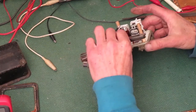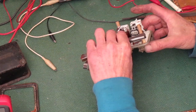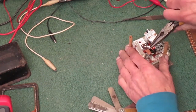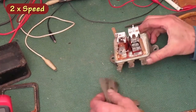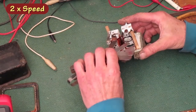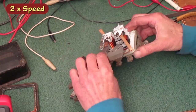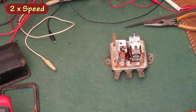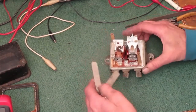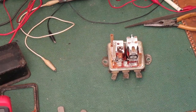That's a little tight. I'm going to check it with the 18 and see if it's close. Nope, that don't fit either. Got to bend it back up a little. Now the 18 fits loose. The 19 fits pretty good. And the 20 is a little bit tight. 19 is close. I'm going to leave it there.